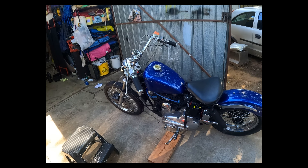I ended up seeing a guy in Salisbury - Rob's Powerhills motorcycle shop - and he gave me a banjo fitting. My mate Mike made me a new piston for the brake because I thought that was the problem, but when I put it back together I looked at the o-ring and it had been cut. The back of the piston didn't have quite enough of a chamfer and it took a chunk out of the o-ring - hence why it was leaking. So fingers crossed it's working, though it is a bit tight and I may still have to take it out and polish it down.